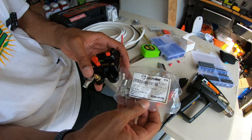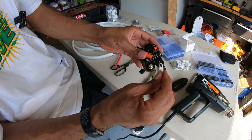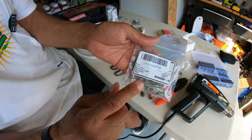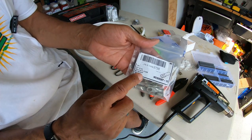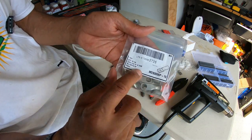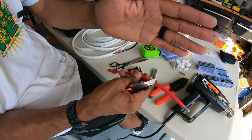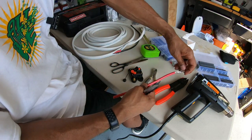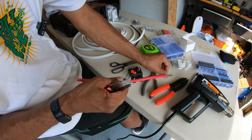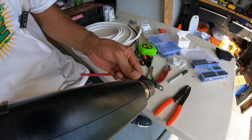All this stuff is linked in the description below, guys, for your convenience. This one is a different size than what goes on to the actual battery. The batteries that I have, the Walmart batteries, Everstart Max, have 5/16 terminals, 6 gauge. So this is the one for that. This is the piece that's going from the battery to the breaker. So the breaker side will get the smaller 1/4 inch terminal, and this side will get the 5/16, both 6 gauge.